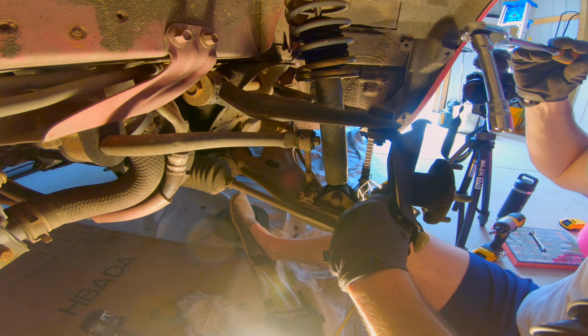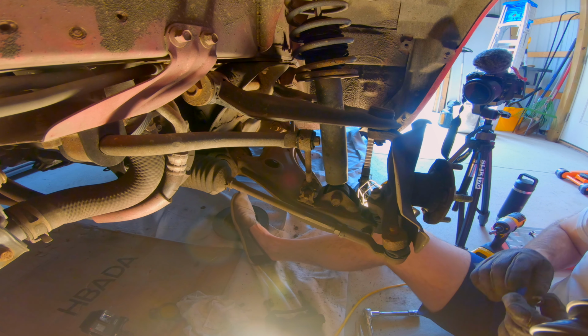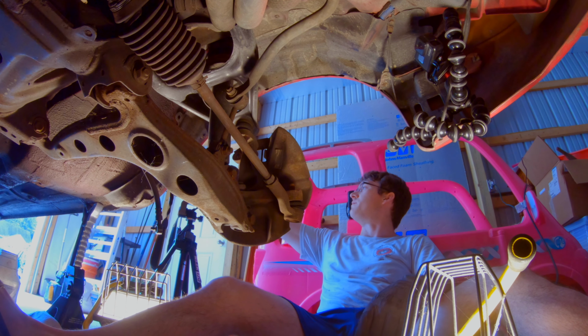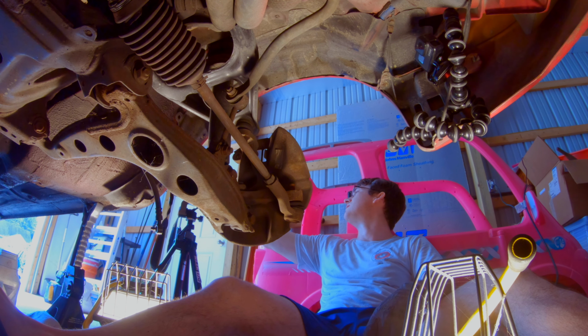So what you do is, there's a hole in the bolt that you put a cotter pin through. Think of a bobby pin, but one that's supposed to be bent. You put it through the hole, and it aligns with two of those castle posts. And so then this literally can't unscrew itself because there's a wire running between it.